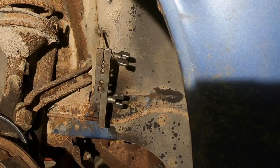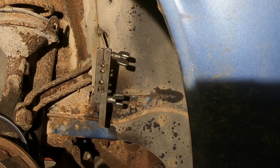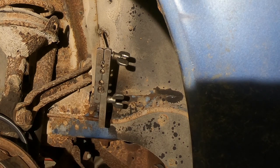Okay, now, I see a lot online from people that are deathly afraid of flaring brake lines, and it's rather simple. The key is to have a good quality set. I'm using a used-to-me Matco set. It is a Matco FT93 FBB double flaring toolkit. I've learned that the main good thing to have is good dies, high carbon steel or whatever composition they are, because you get these cheaper sets from the parts stores, and they're just white pot metal, if that, at best.